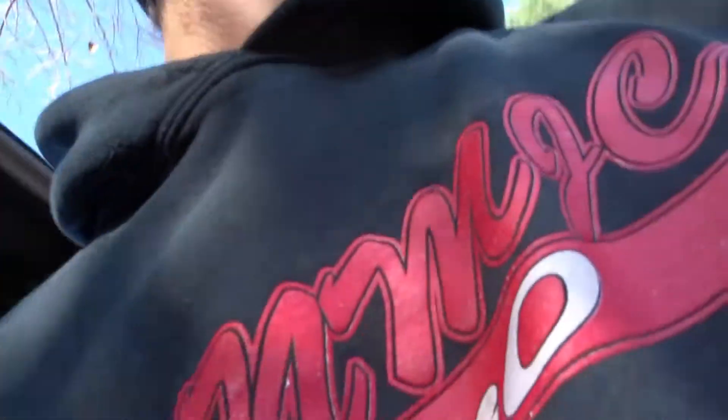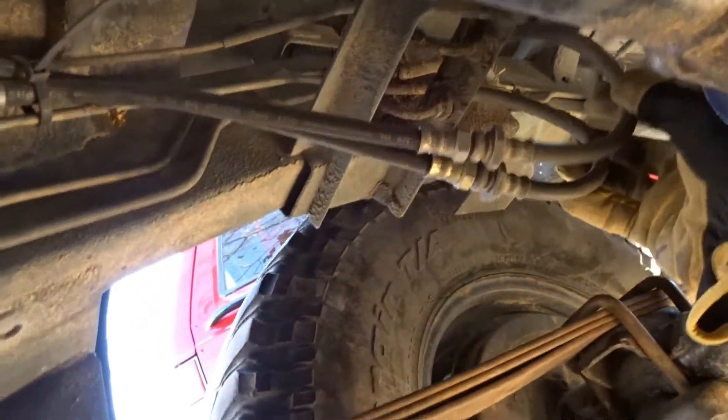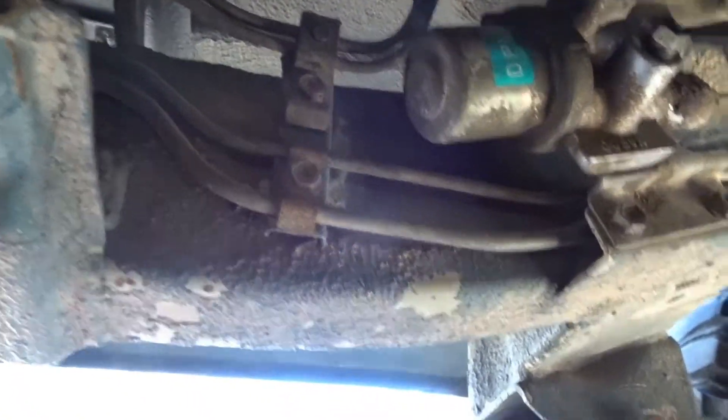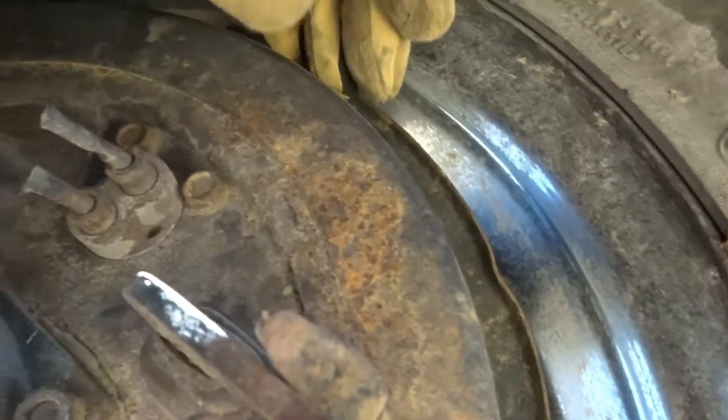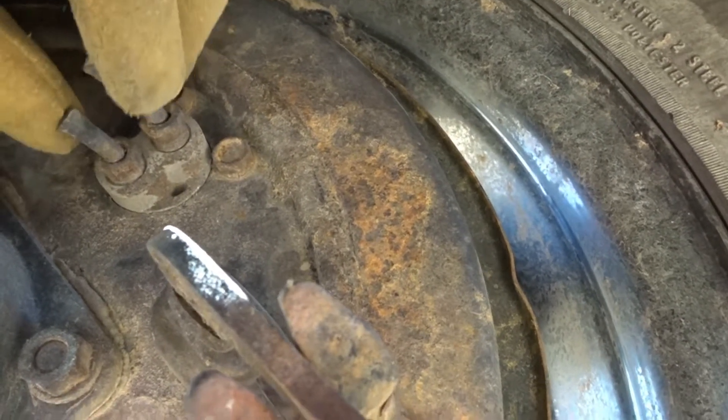Let me show you the brakes here. Here's where the rear brake lines are just wrapped. And then over here, here's one — crimped. There's the other — crimped. And if you look at these, you can see where the brake lines are connected and they're both freaking cracked! Same on this side, right over there.